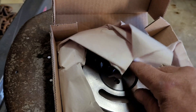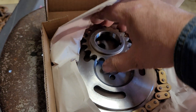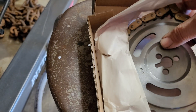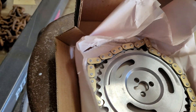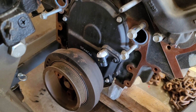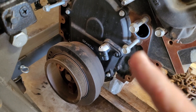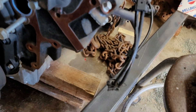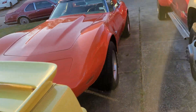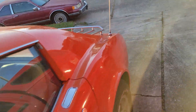There's a difference in the reluctor ring as well — I haven't delved too deeply, but I guess it has to do with how it's timed. So the next couple weeks we're going to pull this back apart, pull the balancer and timing chain, swap those timing gears out, put the other cover back on, swap that fuel rail, and then get this truck up and running. I'll stab it in one day, and the next day we'll see if we can get it fired up.